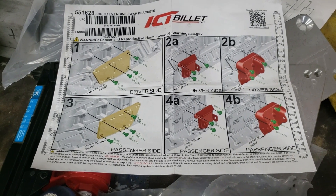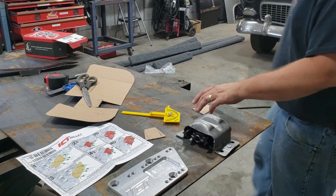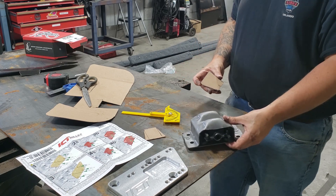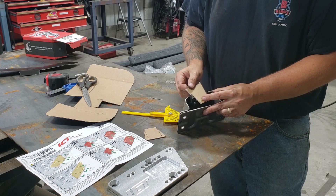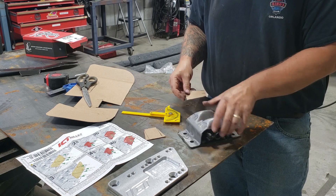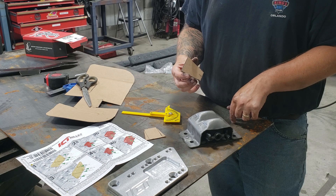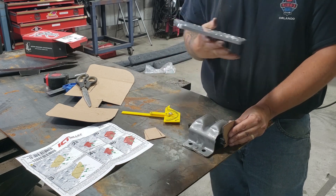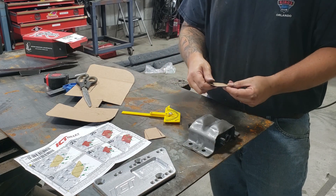So I don't have this red part, and I'm gonna have to make one. I've made up a template for my little ear. I cheated — I have a new motor mount that I'm not going to use, so I can use it as a template. I'm going to make this ear that goes in here so it can pivot a little bit — put a 10-degree angle on it, pop a hole in there on the metal piece. I just need to transfer this template to the metal, cut it out, and then it'll be two of these, plus a flat piece that goes across the top. That flat piece will bolt to the adapter when it's bolted to the engine.